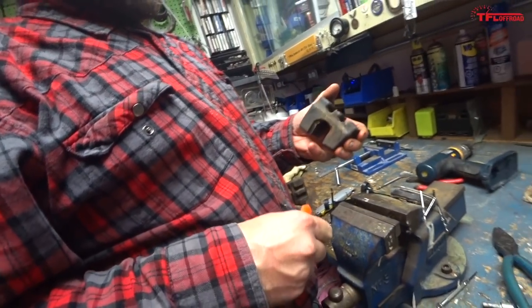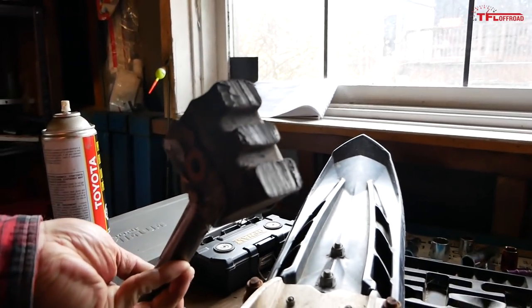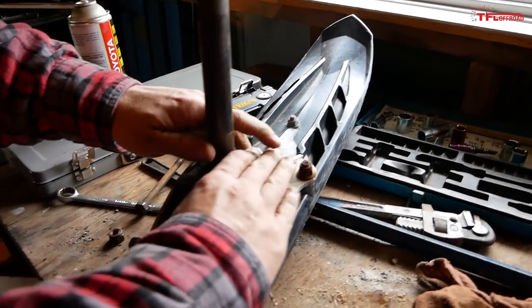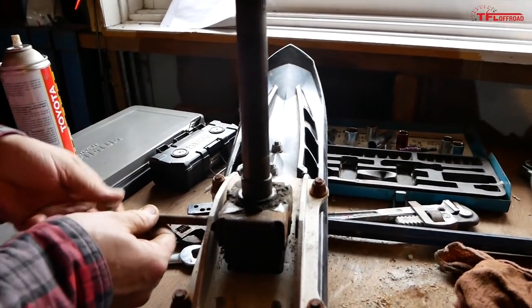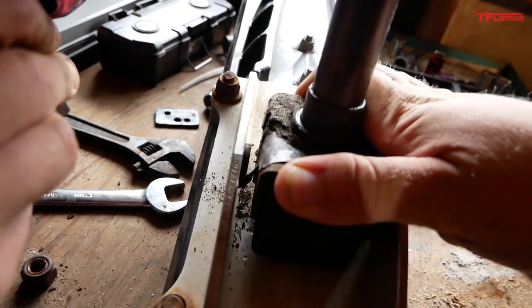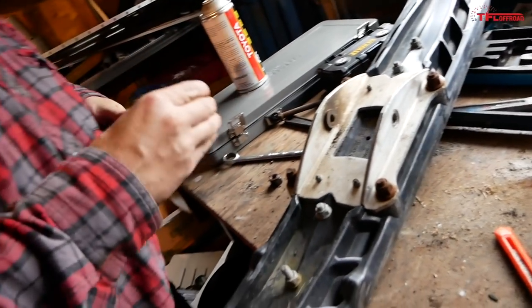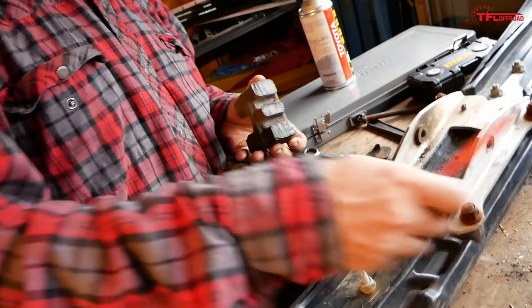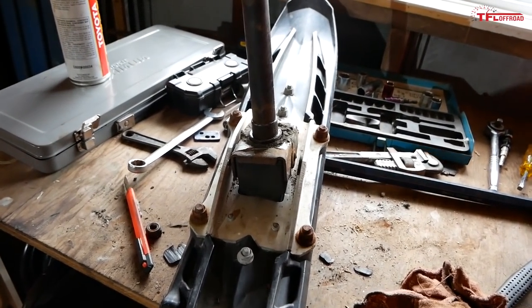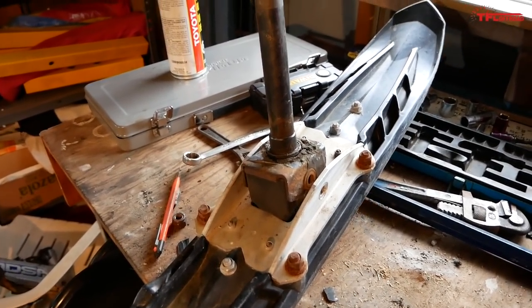Okay. Alrighty, well, hopefully that's enough. Alright, so here's the post. Show them the bottom. So these are the shaved bottoms to just give us a bit more space. They're rough, but if you put it in there and try to fit the bolts, it seems like I cut about maybe a mil or two off. I still need about half a bolt's width. So like another 2 mil. Yeah, this hole on the post is just a little too tall. So we'll do a little bit more shaving, and then we should be in business here. So one fat washer on either side, and then we should have a nice snug fit here. So yeah, you know, we're bodging it together, we're making it work, but that's what budget building's all about, right?